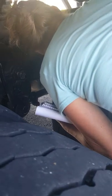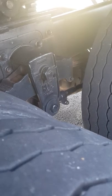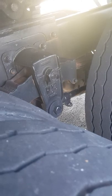I have my torque rod and my leaf spring. My leaf spring is securely mounted at both ends — it is not spread, cracked, or broken. There are no missing leaf springs and no rust trails that would indicate anything is cracked or broken, nothing welded or repaired. This rear leaf spring is a slipper-type spring — it doesn't have the round bushings you see on the front spring, and it's not greasable.